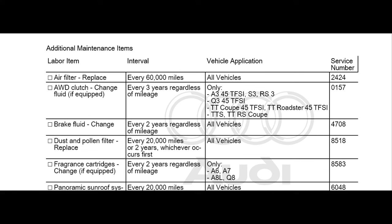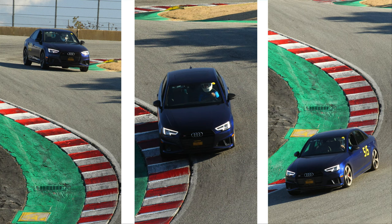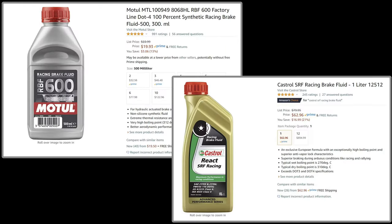When to flush brake fluid? The regular schedule to replace whole brake fluid is every two years, regardless of mileage. Use DOT4 brake fluid. If you go on tracks, I recommend bleeding only the heat-affected fluid after each track day, and bleeding the rest every half or one year depending on your fluid quality. Use extreme heat-resistant brake fluid like Motul RBF600 and Castrol SRF for track days.